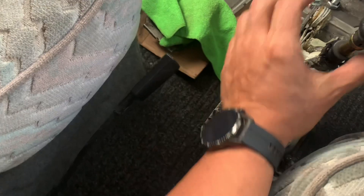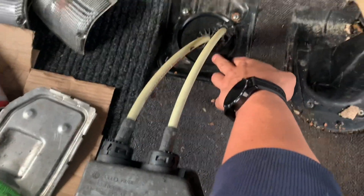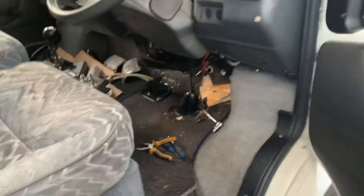This is a false floor, so to make it a little bit harder — it is solid, don't get me wrong — but it could be a little bit firmer down, so I'm going to screw it down here and this side. I've run it through the original shifter area, just cut a little bit of matting out to enclose the gaping holes, and put the original plate back down. Made a bracket — which I showed you before — that's now on a little pedestal made from some old exhaust tube, which bolts onto this. You do need to get to it from time to time, so it has to be accessible for wiring. I'll put two screws through there to hold it a bit tighter. The shifter is in, I'm happy with it — and it doesn't hit my leg, so that's a double bonus.